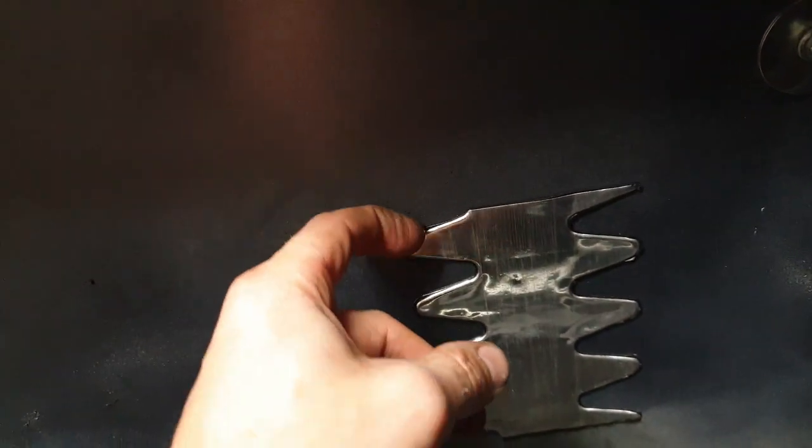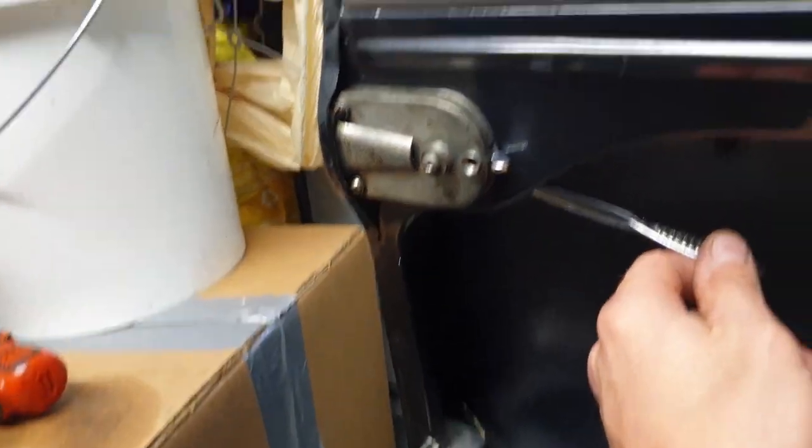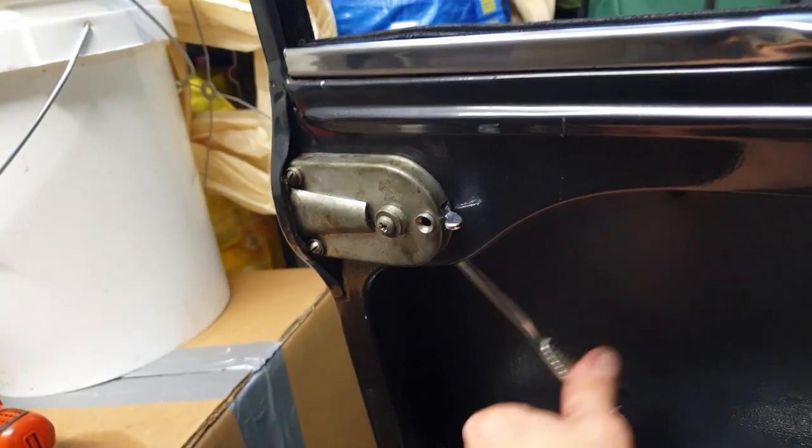on the inside, these 30mm washers have helped spread the load, because before this I think it was an 11 or 12mm washer up against the skin, and it was actually causing it to pull in towards the hinge. So that spreads the load better. I've put two on that one to help pull it a little bit more flat. I've done more waxing in there and all the way up the top. Also, I've given these a good dosing with 3-in-1, and now they work really well.